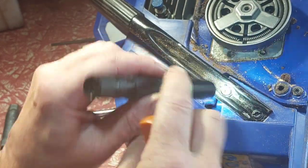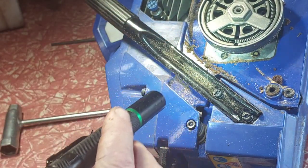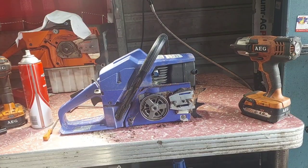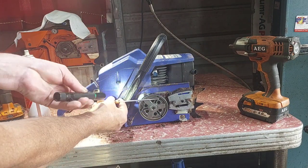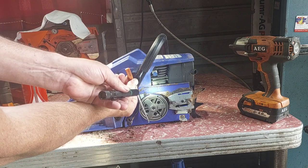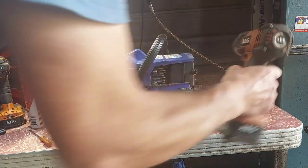It doesn't want to move, but I'm going to clean it up. I'll go back to the ad and find out what the numbers are and which way they go. I had a look at the eBay ad and the line for the oil pump as it sits from factory is here. The ad indicates that three is on this side, two, then one, and four is facing down. So I'm going to turn it to four, assuming that's the max. I don't like that you can't get a screwdriver straight to it, so I'll pull the clutch off.